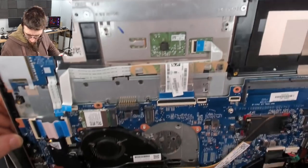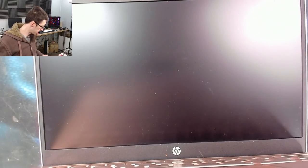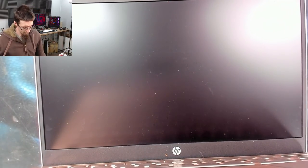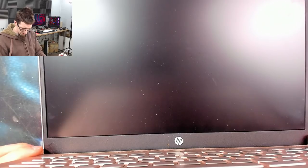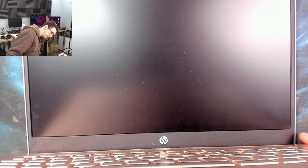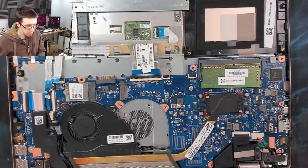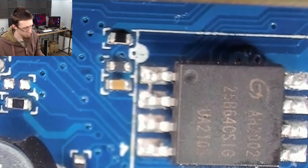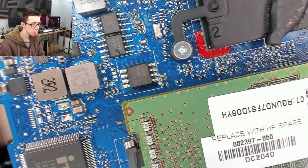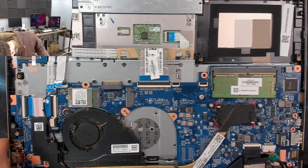Super scuff config. Just need to make sure it still works, then I can take the board out, clean all the flux off, and reassemble properly. It might have a hissy fit because we've reflashed the BIOS. No charger light — I don't like that. I think I've got a tiny bridge on the BIOS chip. Oh you cheeky little... more flux. Probably a bit too much solder on those pads, which is why we're struggling. That should do it. Now we've got a charger light.